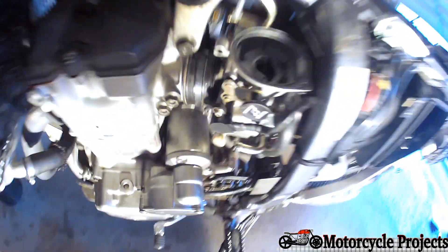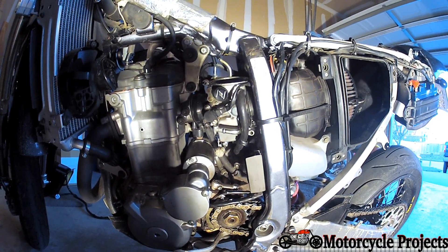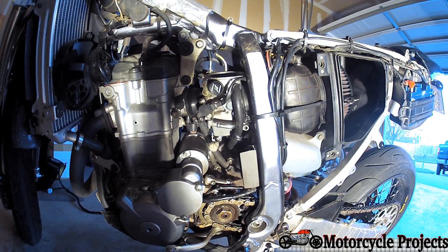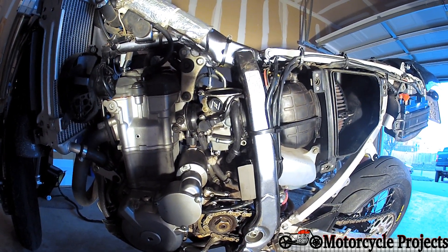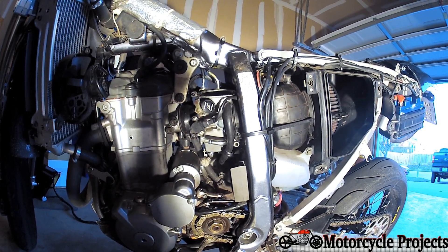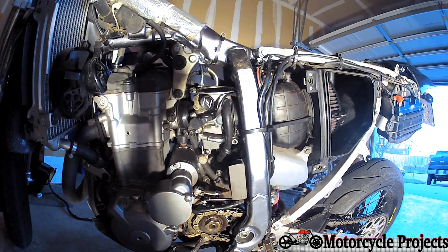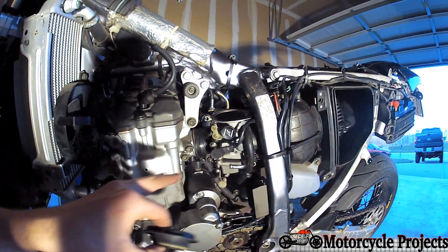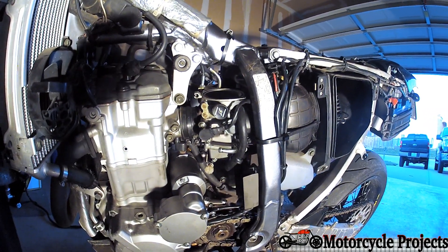There's a hole referred to as the orifice tube, and along the bottom of it is your main jet. In this case, we have a 150 main jet installed, which should be sufficient for the mods — maybe a 155 is required. But the issue we're addressing today is that the bike has a heavy bog when you try to take off. It idles fine, it starts fine, so the idle or primary jet appears to be fine. But as soon as you try to take off at a 16th or an 8th throttle, the bike immediately bogs until you're about halfway on the throttle, which allows enough vacuum to lift the diaphragm and get higher up on the needle — then it runs well enough that the issue appears to be gone.